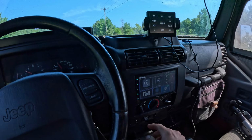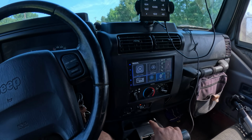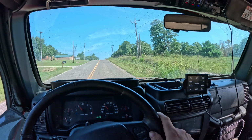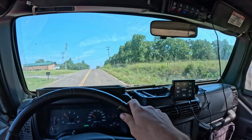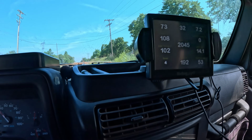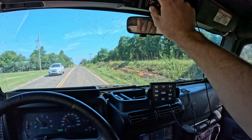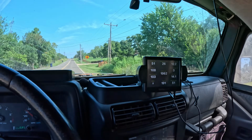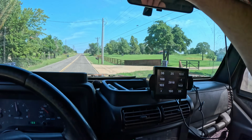So far, the brakes feel so much better, and our manual shifter is working. I think we can rig up something really cool here. So, to enter manual mode, we hit our overdrive switch, and just to test it out, I wired up here. This is now our down switch. So we're in 4. If I hit the button, downshift to third, hit it again, downshifts to second.